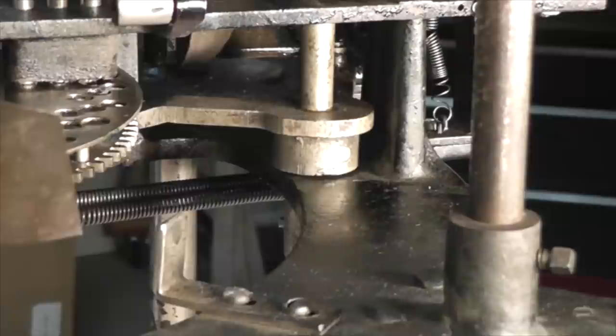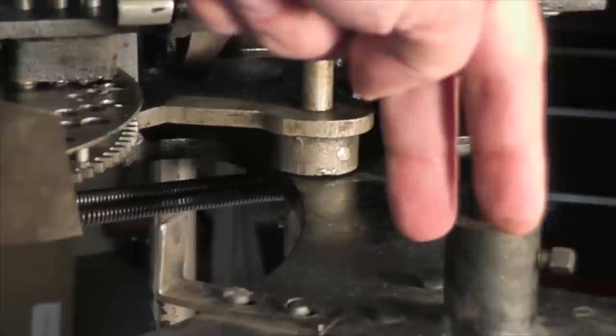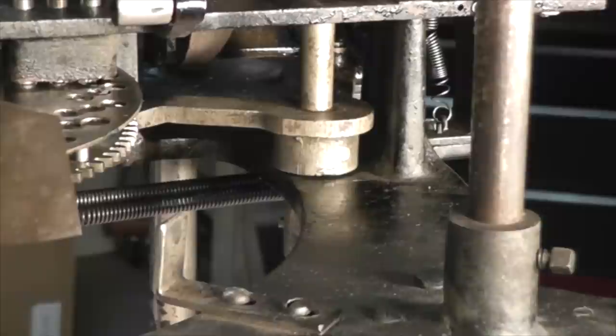And once I started investigating it, I noticed it was hitting this bracket. When I slid the bracket back a few millimeters, it allowed the machine to pay off correctly. If this bracket is removed entirely, it will still pay off correctly for 00 because it will hit the tab on this gear. So that is there only to increase the payout or the return for the house by 10 cents on the large payouts.